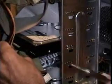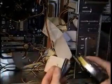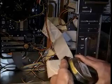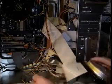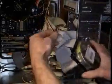Go ahead and pull the power plug off your hard drive. Grab hold of the cable, just wiggle it back and forth and it'll come off. Pull these two screws out and kind of pull it out of there. After you unplug the CD-ROMs, plug the CD-ROM cable into your hard drive — that way you don't have to play with any jumper settings. You can just use the CD-ROM power to power it up.